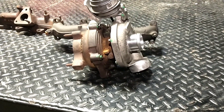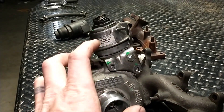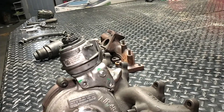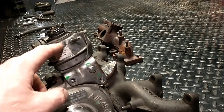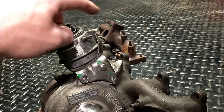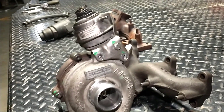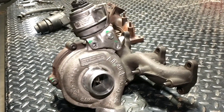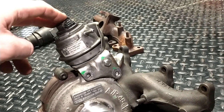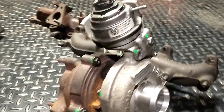I've got this thing clocked kind of backwards a little bit for my electronic actuator because it's going to sit over here. In normal form, this can hit your intake manifold. I'll go ahead and mount it on the engine to show you what it looks like. We do have it with an ALH manifold on the Chevy swap and it still clears — I think we did have to cut one tab off, but overall it makes it pretty slick.